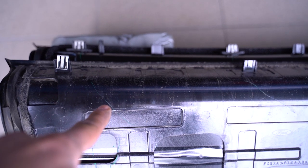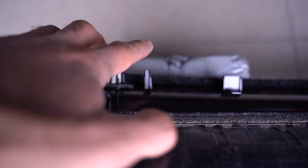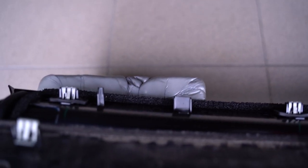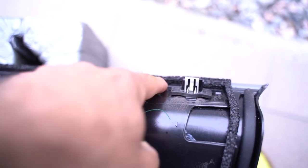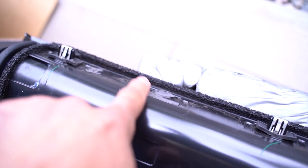With the OEM panel off, I have placed it on top of the Ford Performance one. As you can see, the Ford Performance one has alignment pins on both sides, but the OEM one does not have these alignment pins and there are no holes for them in the trunk. So we need to dremel these out in order to get it into place. That's the next step, and then when that's done we will remove the camera module and put it on the Ford Performance deck lid panel. Now we have dremeled off the extra alignment pins which are not needed and would not have fit.